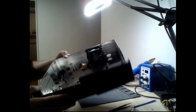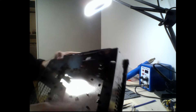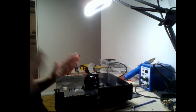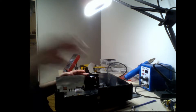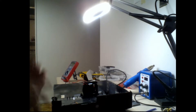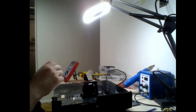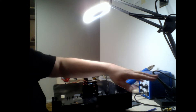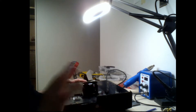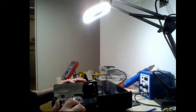First things first, you do have to get everything out. You don't need to take the fan out, but you do have to take these things off here. I've got all the screws out. Now first thing — if you are not comfortable working around things like power supplies, which can have enough voltage — these caps here can have enough voltage to kill you. They don't hold a lot of power, but they hold just enough instantaneous voltage to stop your heart if you mess with them. So obviously it's going to have to sit a while. You have to know what you're doing. If you do not know what you're doing with electronics and electrical safety, do not attempt this.